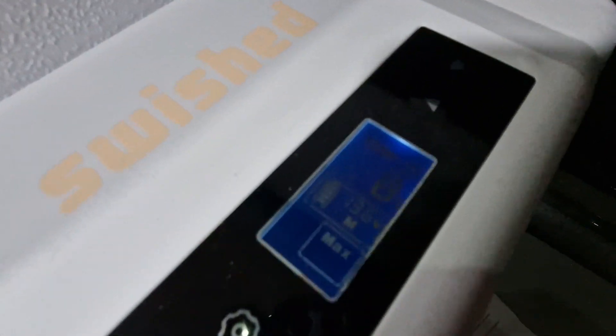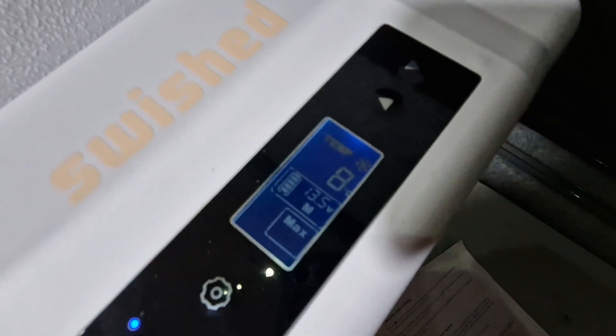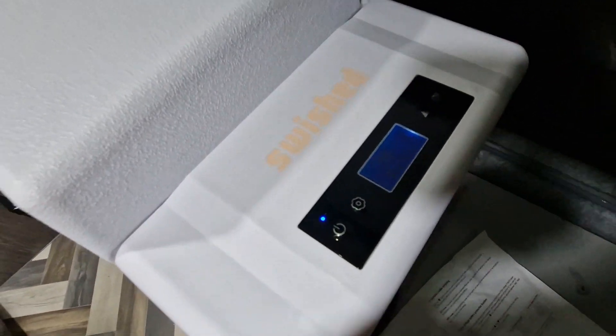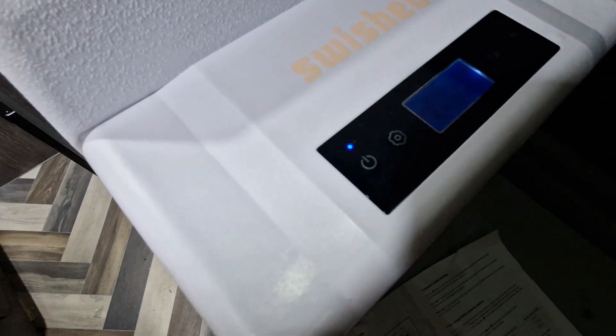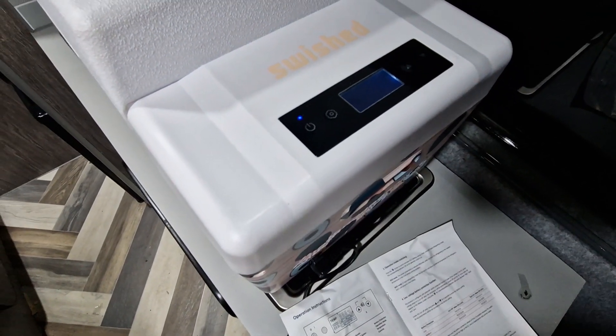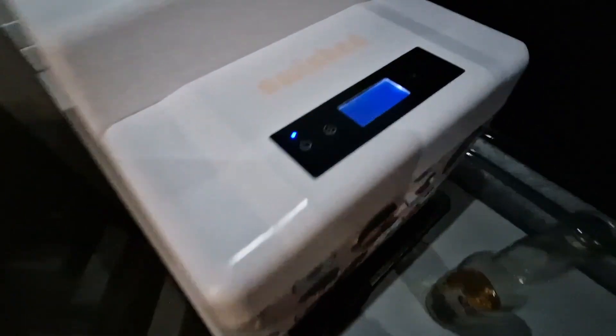So back up to the unit - it's happily running now at 8 degrees. We'll see how long it takes to get down to minus 20. I'll leave this and come back shortly - I'll time it. At the moment now it's 20 to 8. We'll come back in perhaps 20 minutes. Quick catch up - it's now just after quarter to 8, so about six or seven minutes it's been running. It's reporting that it's down to minus 9 already, which is a heck of a difference in such a short period.